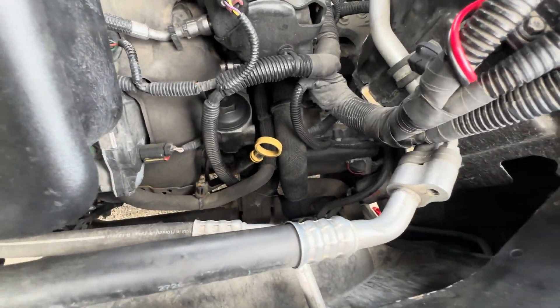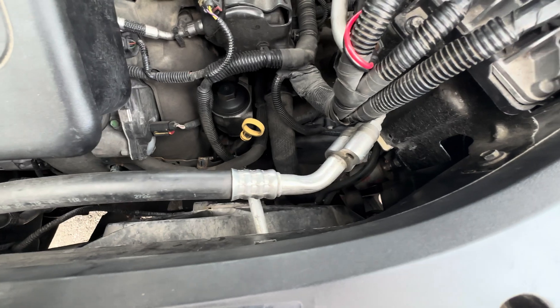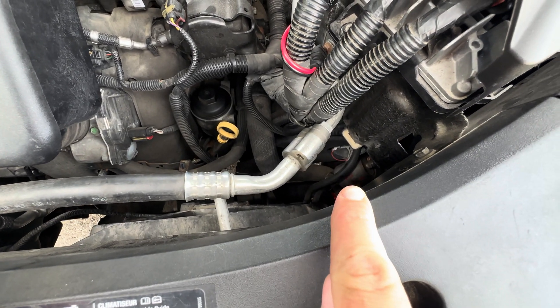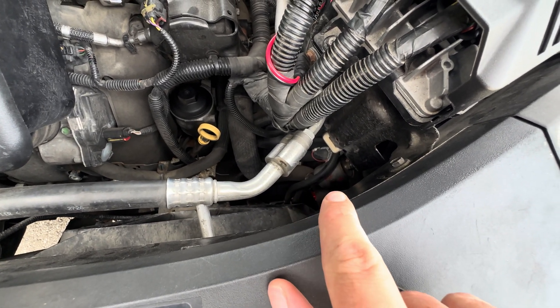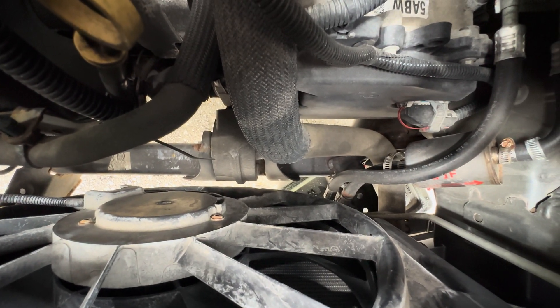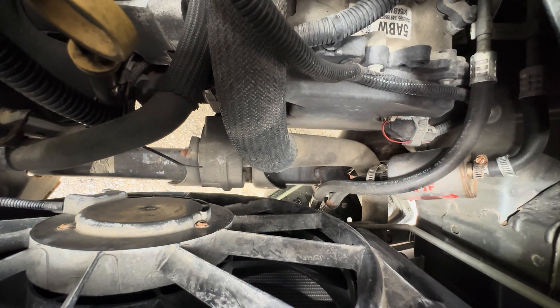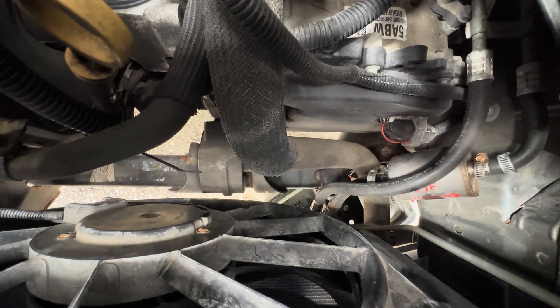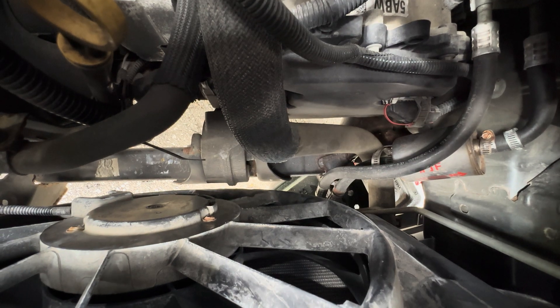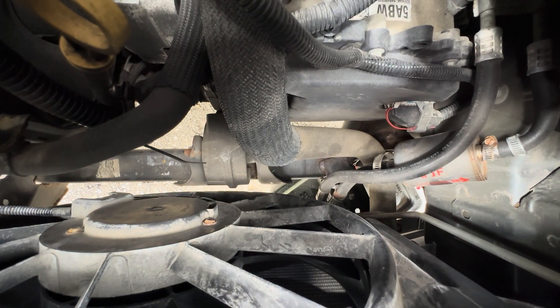I will show you — if you look down, you see the battery on our Ecotec is right there. So if you look right down there, there's that hose going across. That is the cooler line. That is the filter just under it. So if you're looking facing the engine with the hood open, it's on the right hand side hose there, and you can see that the arrow is towards the right for direction of flow if you're wondering how to install that.